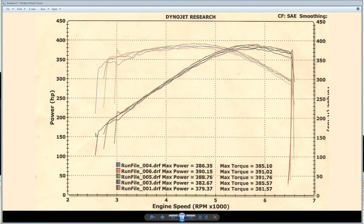Now you've got a chance to see how the car did on the dyno that day. But what you're probably wondering is how the car did compared to when I did a dyno run five years ago with my all bolt-on setup. I'm not going to make you guess — I'm going to actually show you right now. What you're looking at right now is the dyno sheet from five years ago when the car was all bolt-ons. From 3,000 RPM to about 5,800, the wheel torque is always at or above 350 foot-pounds. This is what makes LS engines so great — they have this nice flat torque curve and you just ride this wave of torque throughout the entire RPM range.